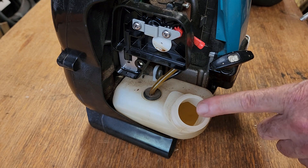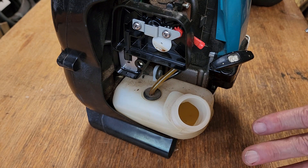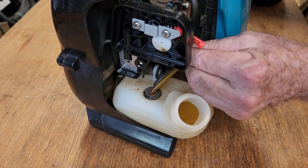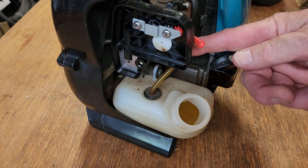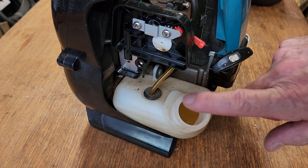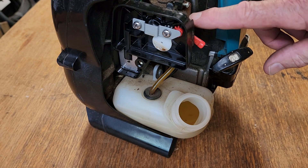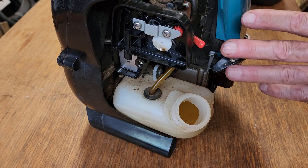We'll tip this fuel back out and put some fresh fuel in again before we go to start it. You don't want to do that in an enclosed area or while you're smoking because you're going to get some volatile fumes coming out of the tank — make sure you've got a well-ventilated area. Now we can put these hoses back onto the carburetor. The clear one goes on the outside, the other goes on the inside. If they're at all hard I would suggest replacing them.